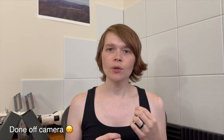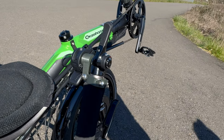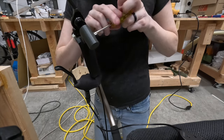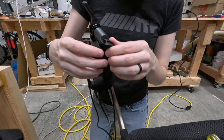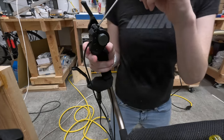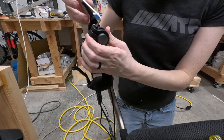Over on the right side are the brake sensor and throttle. The brake sensor is a little push switch that actuates when I pull the brake. I screwed a little loop of wire onto the brake, then very carefully zip-tied the rest of the assembly such that the switch trips almost immediately after I start pulling the brake. In fact, if I pull very lightly, I'll activate regen without engaging the mechanical brake. Also on the right handlebar is the throttle. This uses a custom 3D printed clamp to attach to the handlebar, with affordance in the clamp to pass the other shifter cable down. There's also a GoPro-like attach point on the left side that attaches a little nubbin raised just enough so the throttle lever is at the right location for my thumb. Mostly I use the throttle to aid in going from a stop — sometimes I want to cross a semi-busy street and this is the quickest way to get going. The way pedal assist works on this bike means I don't get instant assist; there needs to be some actual rotation before the bike will apply assist. Other times, I just don't want to pedal.